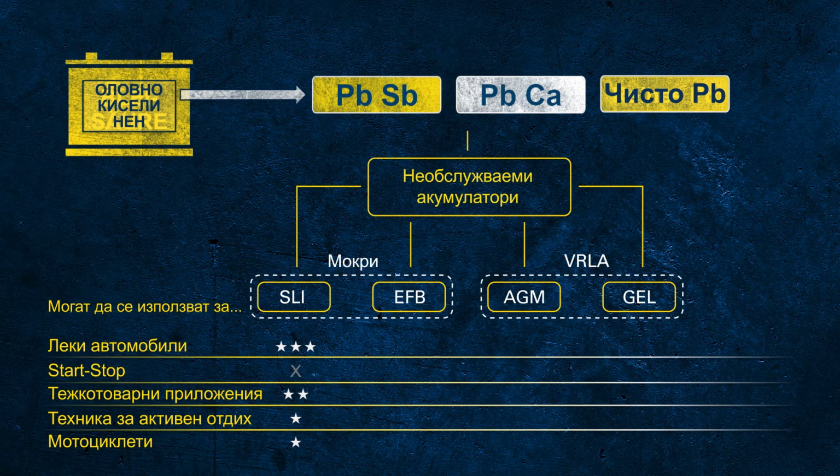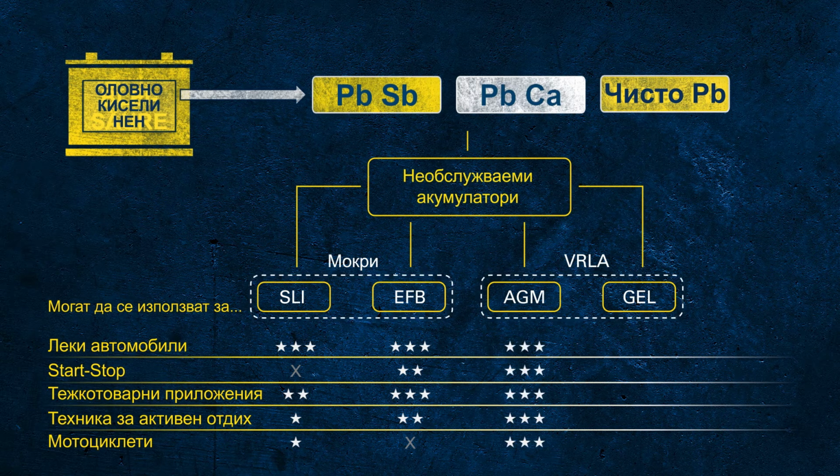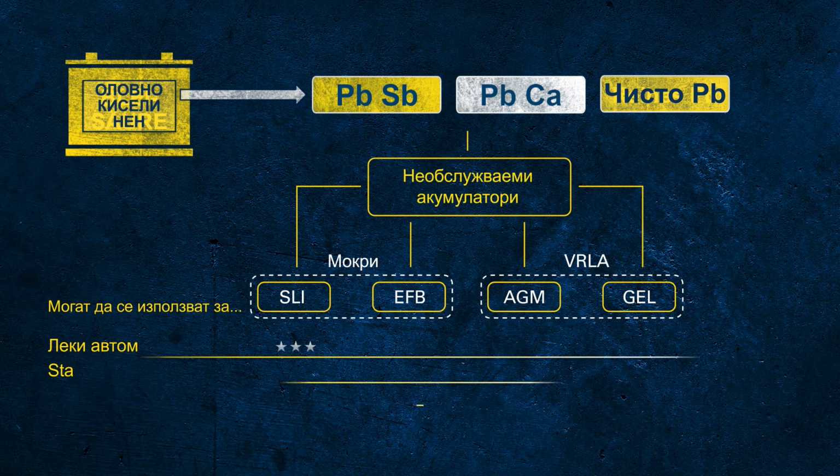In the EU, more than 90% of all newly manufactured vehicles are coming with start-stop systems in order to meet CO2 regulations. As mentioned, the EFB battery is an enhanced battery in order to support basic start-stop systems, but comes to its limits in more aggressive start-stop systems or cars with a lot of electrical consumers. AGM provides outstanding performance for all applications, also for high-demand electrical systems of luxury cars and SUVs or fully equipped long-haul trucks with an electrical parking cooler. Gel batteries are not very common in automotive applications, but they are often used in leisure or motorcycle applications.